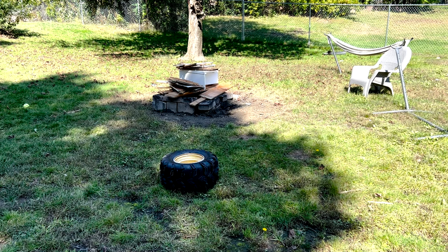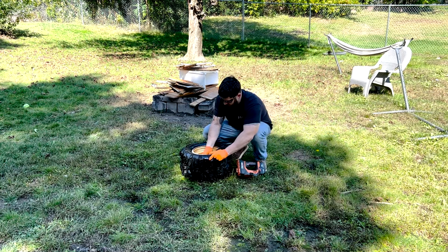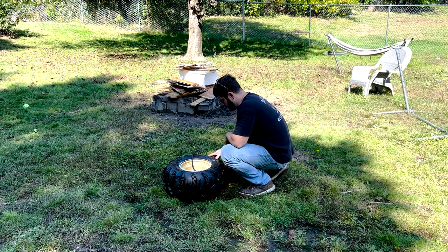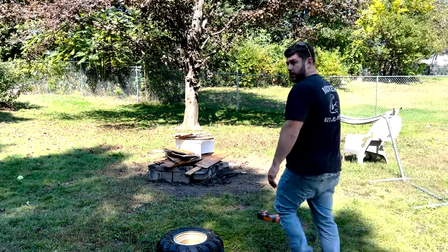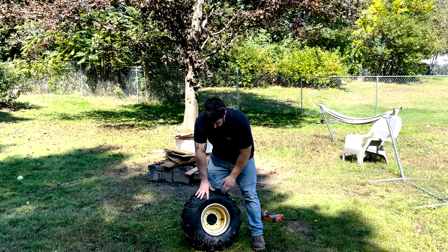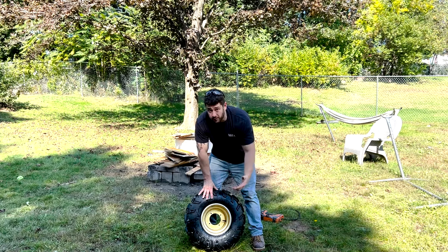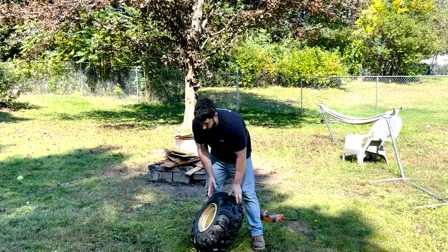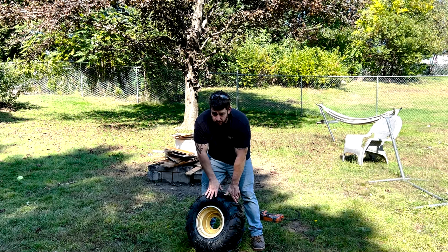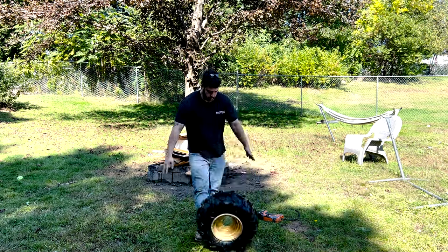That didn't seat the bead the first time. Let's pump it up a little bit — we're at about 9 psi, which is good for now. The bead is seated and it's on there nicely. Just gotta still do the other tire. That's how you seat the bead with fire in the hole — again, very dangerous. Always try the strap first, or just go to a tire shop. This is more of a pinch method for when you're four-wheeling off road with no other choice. A little bit of ether or brake parts cleaner, spray a little bit in from a distance, glasses on — there you go.